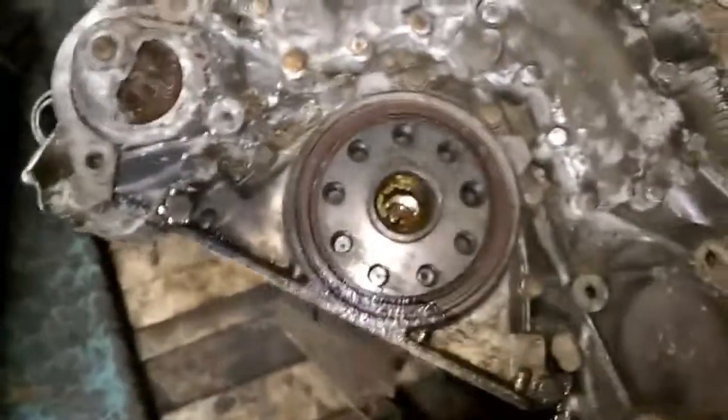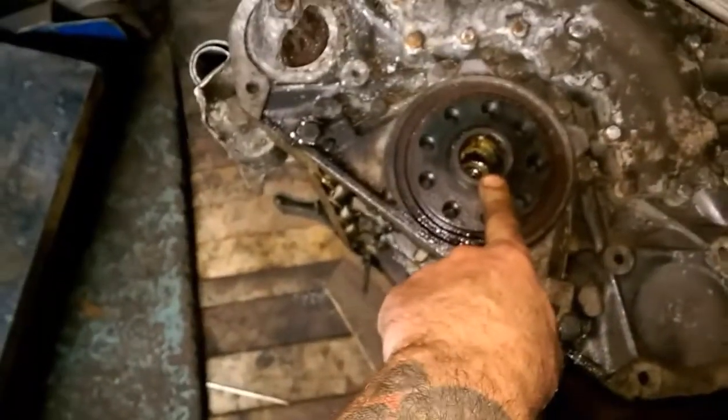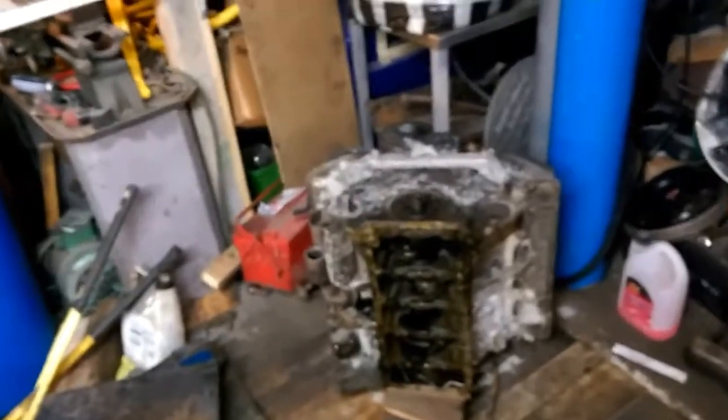There she is — I got her out of the pit and got her on her nose. I changed some of the rotten pit planks; I need to get about 10 to 12 foot scaffolding boards to replace all my wooden planks. The next thing to do: I could have sworn I had left a release bearing in this engine, but I obviously took it out. So I'm going to have to quickly machine something up on the lathe to carry the nose of the gearbox. She's out, and the next video will show it all together — ready for welding.